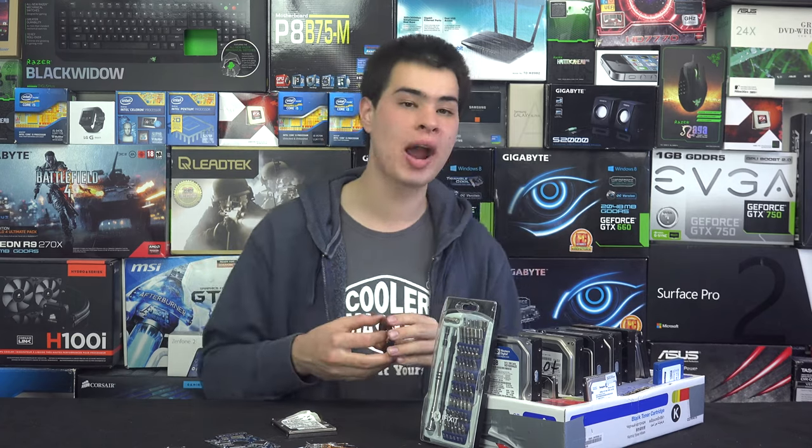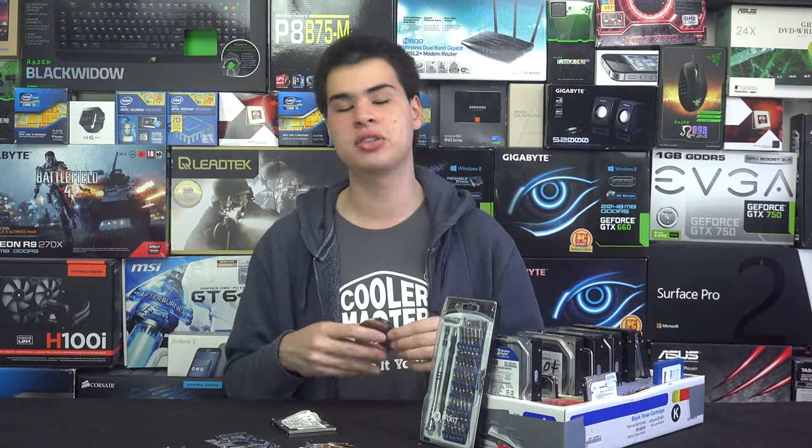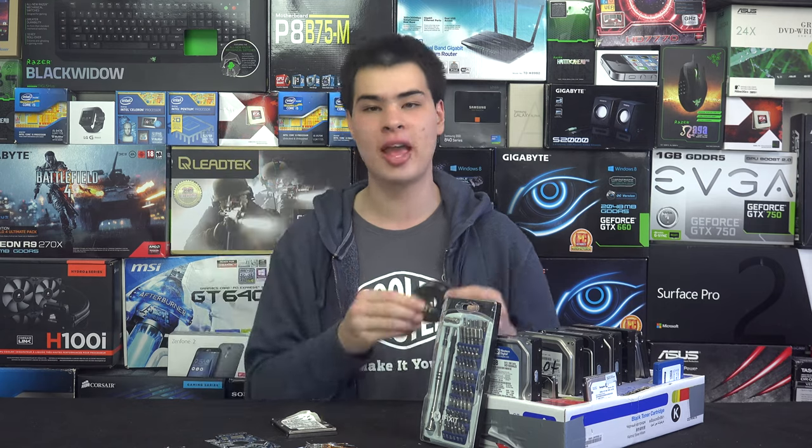That is the quick and simple way to dispose of your hard drive. Again, this will apply to larger 3.5-inch drives and may apply to SSDs. However, SSDs work differently and don't have spinning platters that can be easily read off. Usually, if they die, they're dead and no data can be recovered from them. Of course, you could just throw them in the bin, but again, you're leaving yourself vulnerable for people to pull your data off, possibly sell it, or even hack into your accounts with the data stored on these disks. That is definitely a secure and fast way to dispose of your hard drives. Now, if you did want to take it a step further, you could use what I'd call the industry standard — actually corrupting the full hard drive before physically breaking up the disks. But for the average person, you don't really need to do that step.